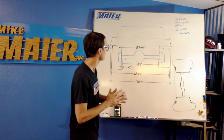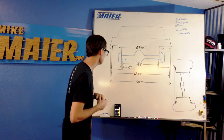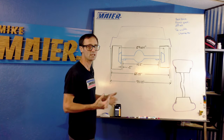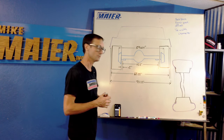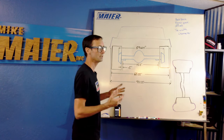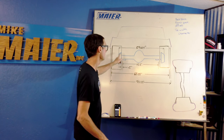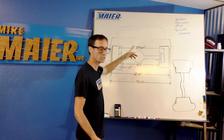What we have here is an old school Mustang, because that's what we do here. This is the back axle of the car. We're just going to go over some numbers — it's going to be kind of a clunky video, but we're going to go through some things for you to be attentive to. I measured up a guy's car the other day; it's a 68 Mustang. 68 Mustangs have an axle housing width of 59 and 5/8 inches. It's a stock eight-inch housing.